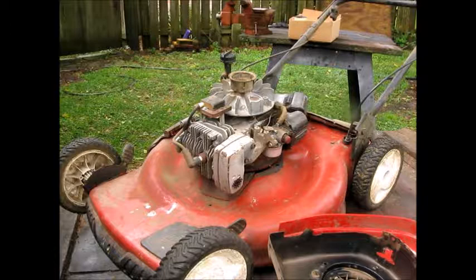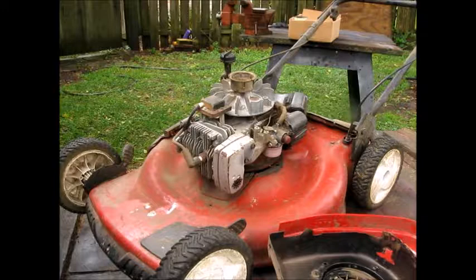So I'm going to go set up the pressure washer, and I'll find a spot. Lawn's getting high. Got to get one of these lawn mowers done so I can cut my lawn. All right, we'll be back in a little bit. She looks pretty good. She's just dirty. And, you know, we'll go through the usual procedure. We'll check the magneto, pull the plug, pull the carb, right? And it probably needs everything. You know, clean the tank out and just go through all of it. I don't think there's any issues with it.